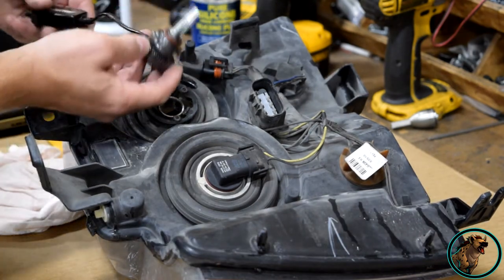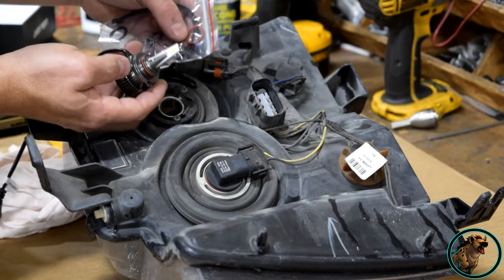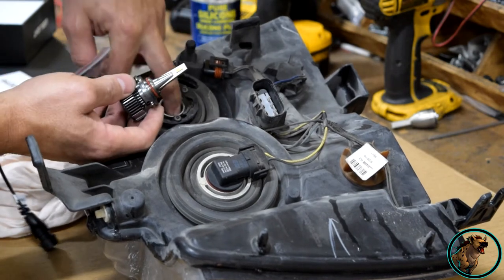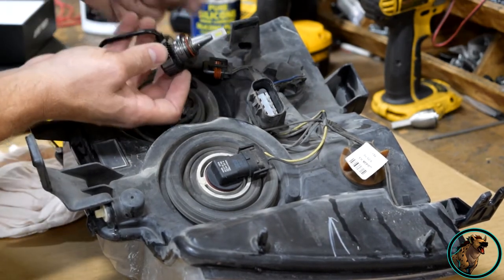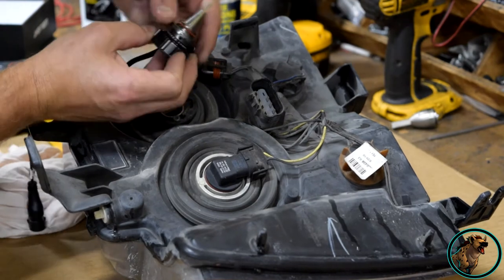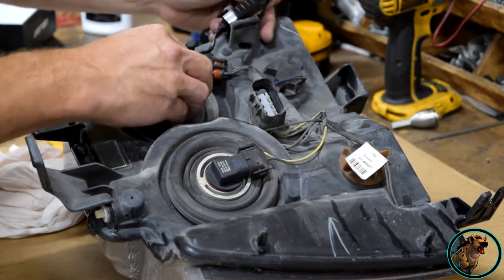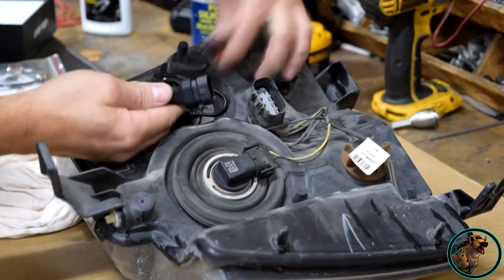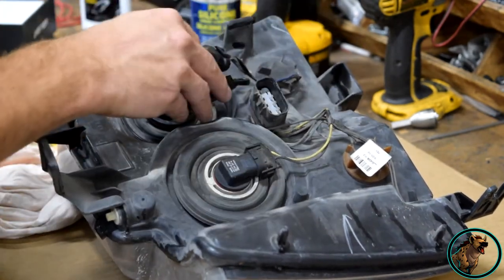Get the LED out of the box — right out of the box they're really good to go. If it's too loose there's an o-ring assortment in the packaging you can swap out to accommodate whatever size opening your headlight has. If the locking tab needs to be clocked differently, there's a little Allen wrench in the kit so you can loosen and rotate it as needed. To install, just put it right in like you took the bulb out, twist it 90 degrees, make sure it's good and positive, then plug in the connection — that's it.